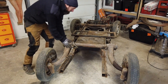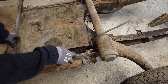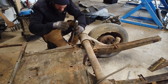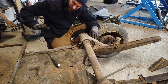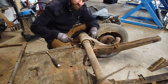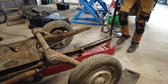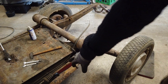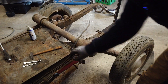Next piece is the rear axle. To remove it I need to remove the split pin holding in the knife point. Before removing the axle though, I need to jack up the chassis, because right now the suspension is what keeps pressure on the axle to keep it down — if I just remove it now it would collapse completely. There's still tension on this one, so I need to unscrew it a bit to release the tension, otherwise I'll just wreck it.